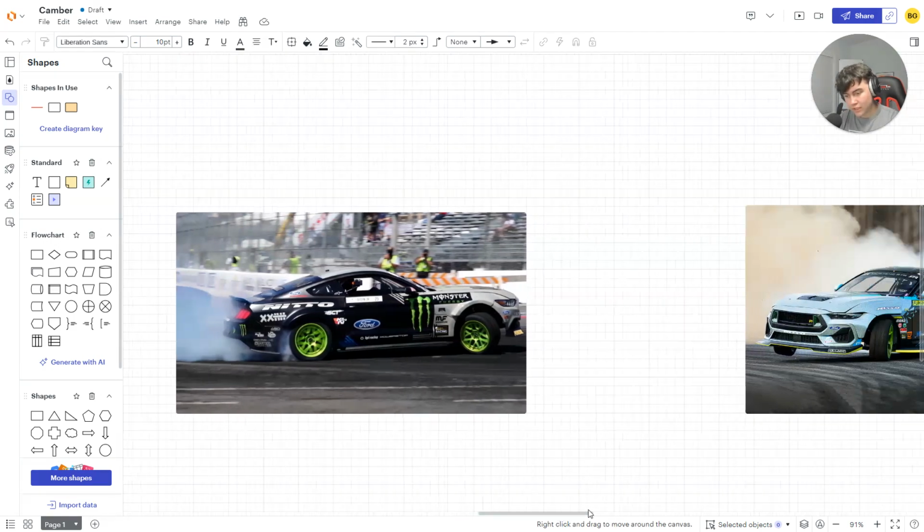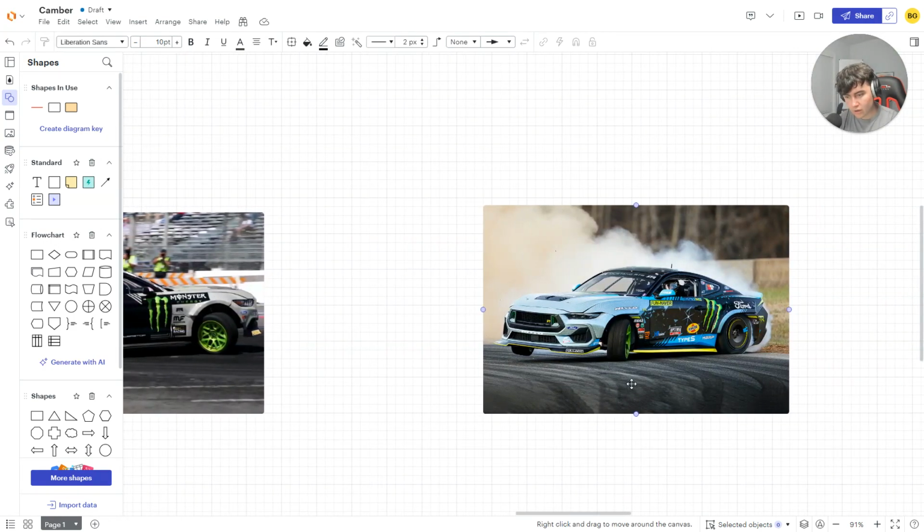Now, if we look at this newer car, I think this is the 2023 car, I want to say. Anyway, this has a lot less caster. If we were to run it at the same -3 degrees of camber, it would not be so much like this, but more like this when it comes to that leading front wheel. This is at a decent bit of angle, about, I'd say, 60, 70 degrees of angle the car is at.